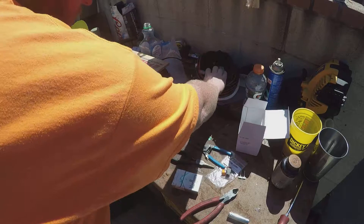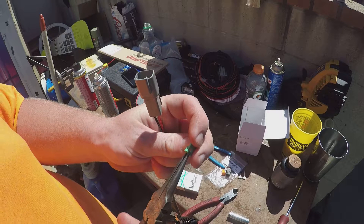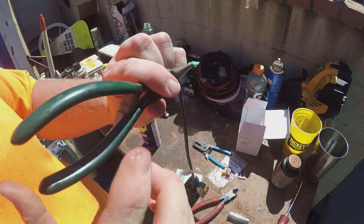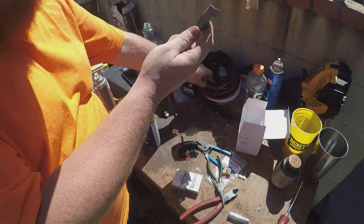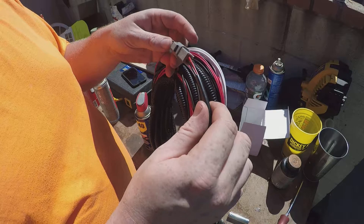You're going to take this green wedge lock and a pair of needle nose pliers. Look down inside — you can see there's an opening similar in shape to this. You want the tang end to go on the bottom, because way back in there to release this if you have to take it apart are two little tangs. You'll pull this out and use a pocket screwdriver or thin pick to push those while pulling on the wire. Insert the wedge lock, then use a screwdriver or needle nose pliers to push it into place until it's flush. These will not go anywhere. Now we just take it onto our SR-mini harness — that snaps together. That is a waterproof connector. This will sit outside the vehicle with no need to worry about any water intrusion.